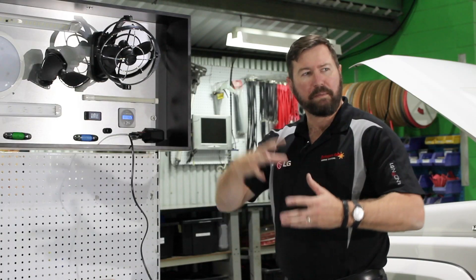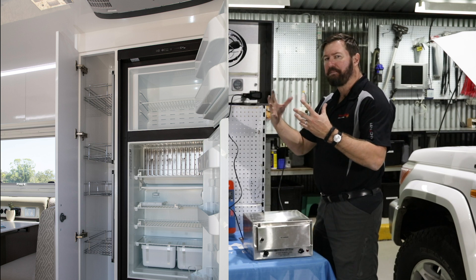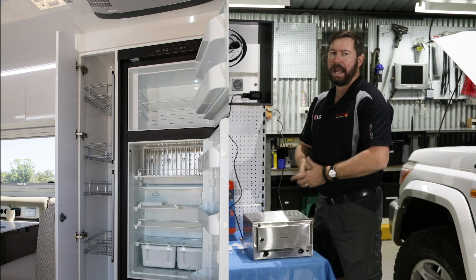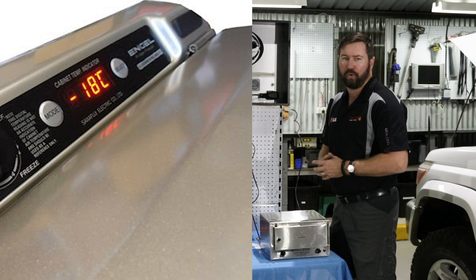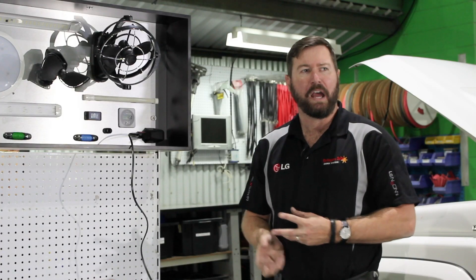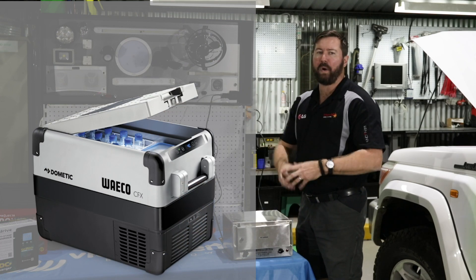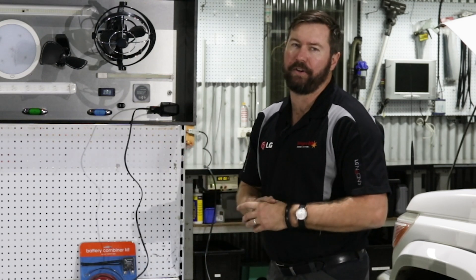Beyond lighting, one of the biggest things we need to power from our auxiliary batteries in our RVs is our fridge — our refrigeration. Determining the power draw from a fridge is a grey area. We need to know how you're using it: how big is it, how many litres, how cold do you run it — minus one, four degrees, or as a full freezer. Small 25–40 litre fridges are going to draw anywhere between 20 to 30 amp hours per day — about an amp an hour when they're quite cold and you're not in the tropics. Whether it's a Waeco, Engel, Evakool, or any other brand, a small device if it's fairly new will draw between 20 to 30 amp hours a day.